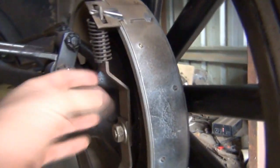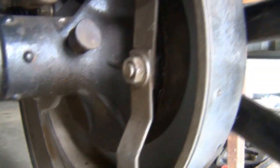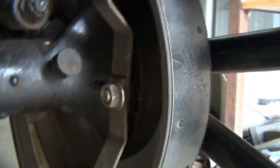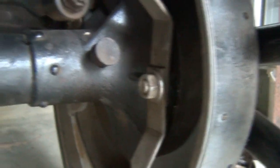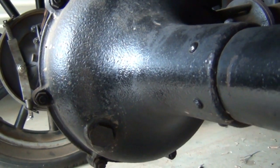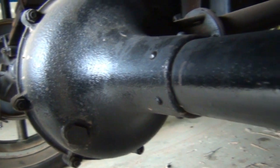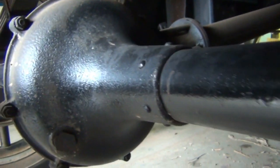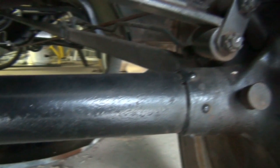You can see I've installed the Rocky Mountain brakes. You can still see the original brake drums - they still work - and now we've also got the Rocky Mountain brakes which are for stopping. In the event that the transmission brakes fail, or indeed the Babbitt thrust washers inside the diff - although I've actually got brass ones in here - the originals were made of a rather dicey material called Babbitt which tends to disintegrate over time.